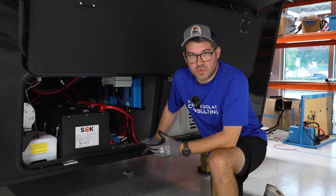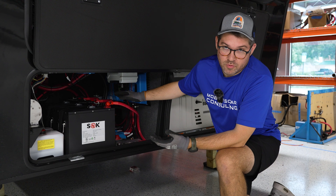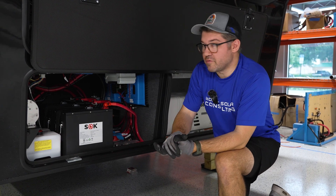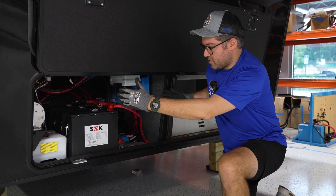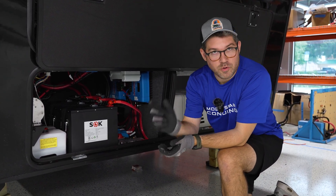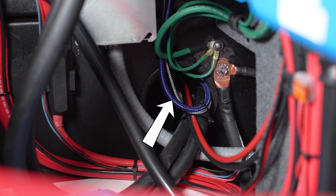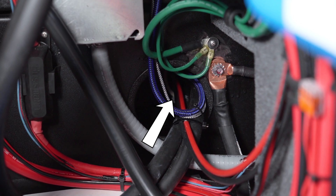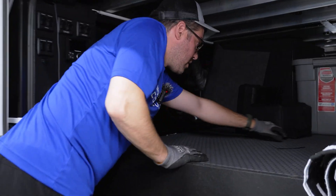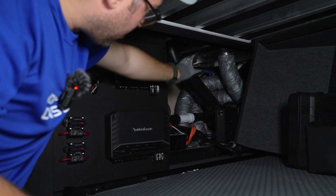One of the interesting aspects of this build is the way we ran our wires through the underbelly of the rig. On some Brinkleys there's a lot of space under there, which makes it easy to run main power cables and PV wires. But in this one, there are storage tanks on either side, and there are actually some screws sticking up in the one area where you could run wires. So to protect the wires, we ran a three-inch PVC all the way through toward the rear of the pass-through, through the center under here and right into this closet area in the pass-through, which goes up into the bathroom.